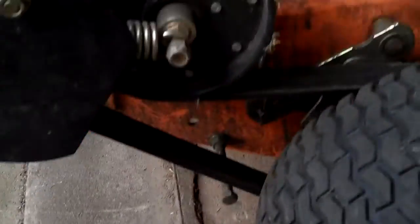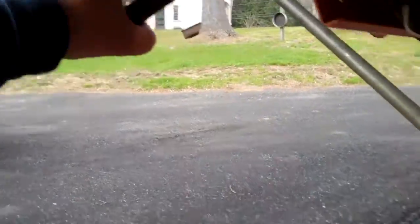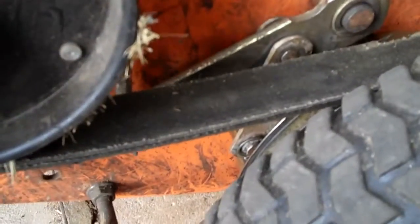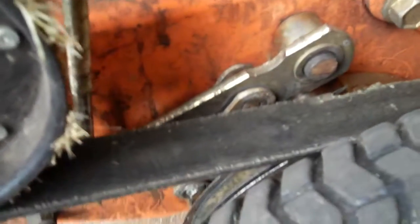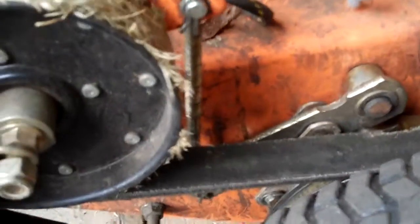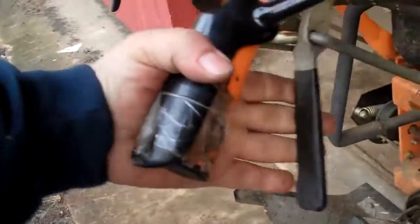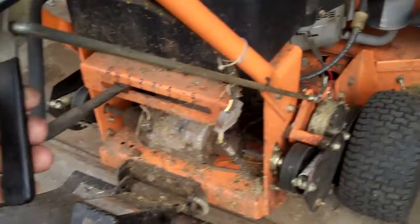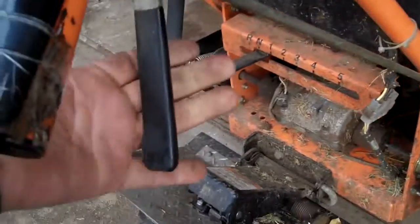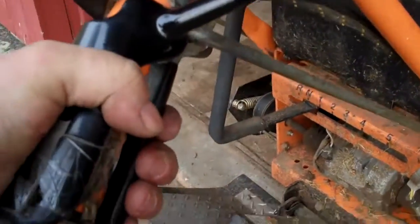Let me put this pin back in here. The way I like it: when I pull the handle, you disengage the drive pulley and then a split second later this other lever gets pulled up, which engages the brake. I don't like having the lever out too far — I like it so the drive is just engaged and the brake is applied. I don't like when the lever's way out, it's just too uncomfortable — I like it up in here pretty tight.